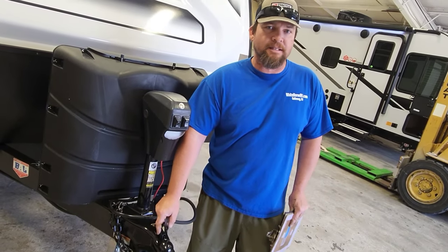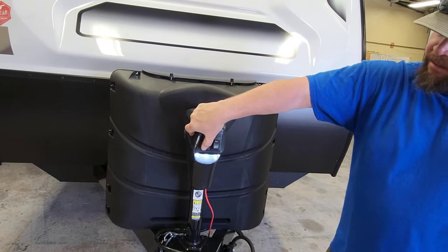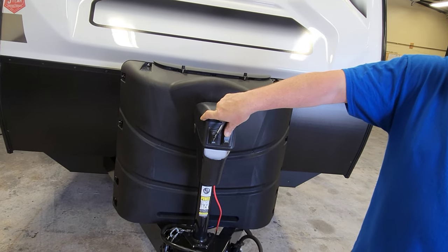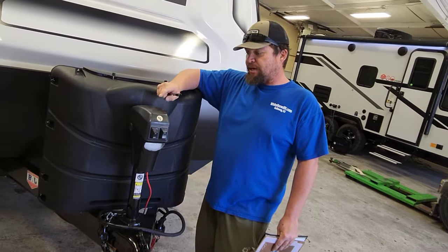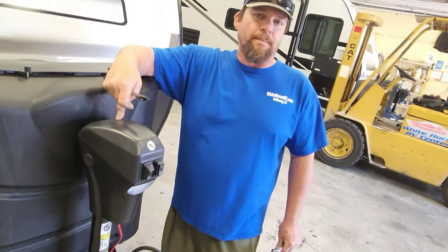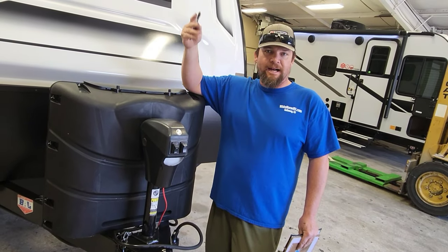Maybe a carabiner or a locking mechanism. Your jack system is an electric jack. You have a light on it so you can use it at nighttime, and an up-and-down switch — extend and retract. That's a nice feature; it'll save your back. Just in case this feature ever stops working, there's a rubber cover on top. Pry that off and there's a nut — you can put a wrench on it and manually turn the jack. You won't get stranded as long as the jack is intact.